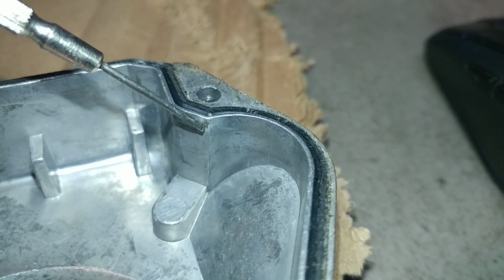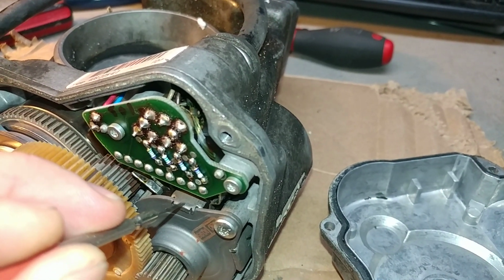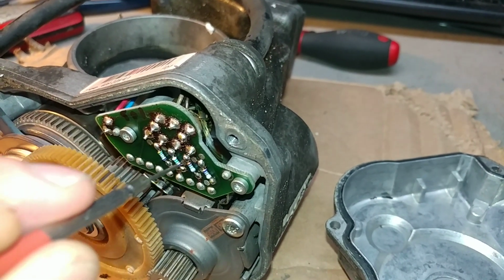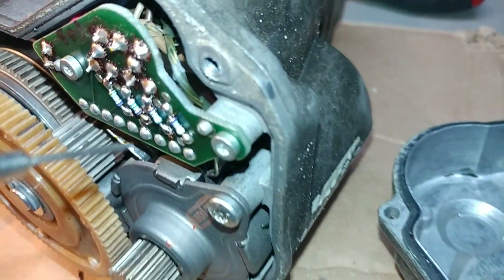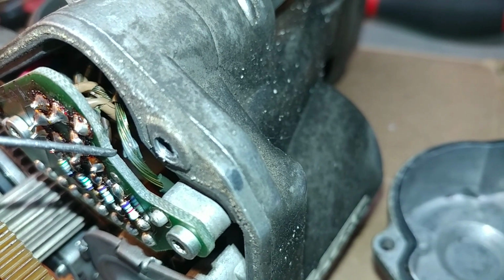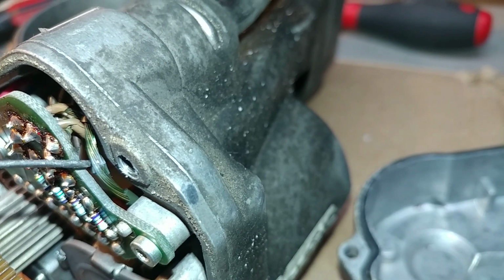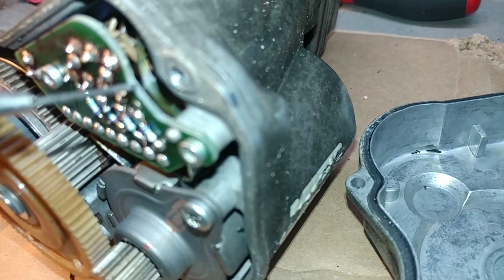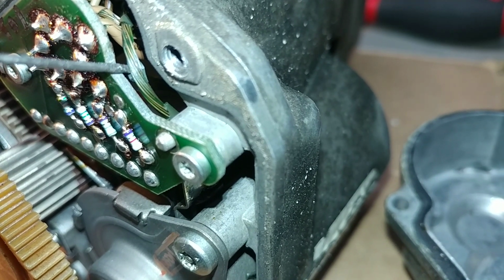Right exactly here. What happens is the motor itself is bidirectional, whichever way you call it, but it goes forward and backwards. So polarity on these wires changes. And the case is obviously chassis ground, vehicle ground. So this would create a short to ground. If the motor spins one way where this is negative, then it's fine. But when it spins the other way, when it's positive, now it shorts to the chassis ground, and therefore it gives troubles. It creates issues with acceleration rather than engine running. So this is basically my primary target here. Is this the problem?